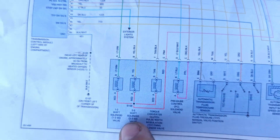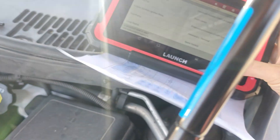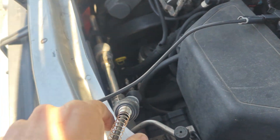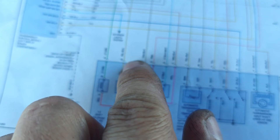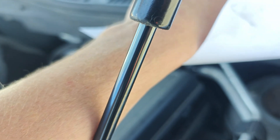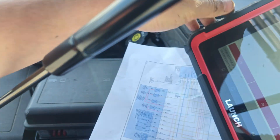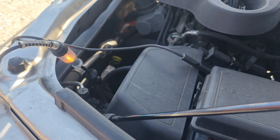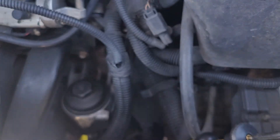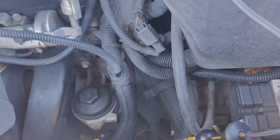It's light green — that's the control. I'm going to go under output controls. I'm on our yellow and black, so that's our 2-3 control wire. There are two yellow and blacks, but I got this connected to battery positive so when we turn it on our test light should light up on the right one — and it lights up! Our driver's good, our wiring's good up to our connector.